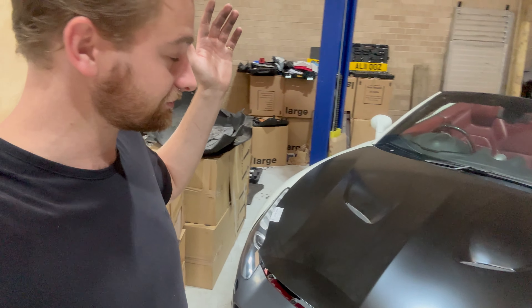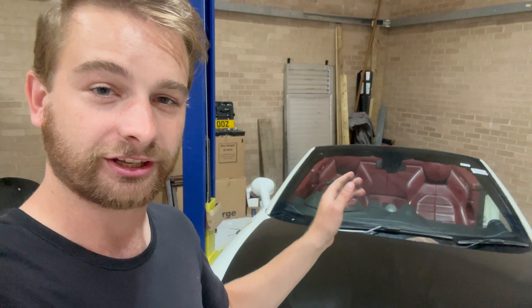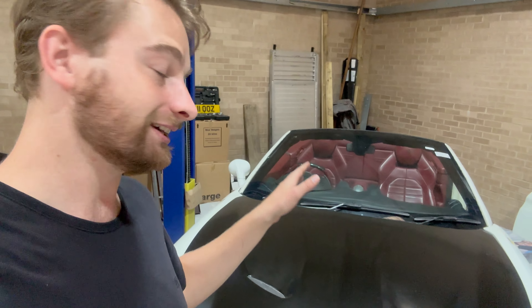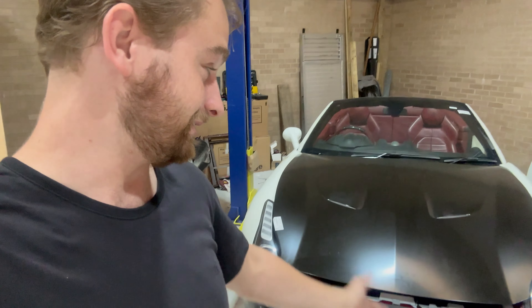New day and I've actually got the Aston Martin DB11 out the front — I've gone and collected that. It's nice to be reunited with the car but hopefully by the time this video comes out it will have been sold. So we're on the Ferrari and we've still got this immobilizer issue. I've called Ferrari because there is a pin code that you can use to start the car without the key fob — I think it's just not recognizing the key anymore, so I need to get it reprogrammed. I've called Ferrari, given them the VIN and reg, and they've said leave it with us for a couple of days and we'll see what we can dig up. So hopefully in a couple of days we will have the pin code, get the car started, get the door on, and get these last bits painted.